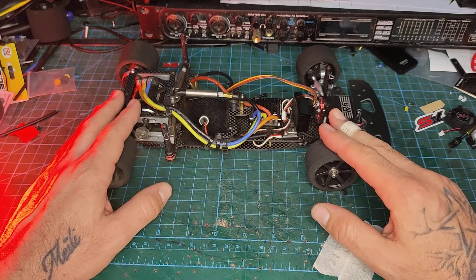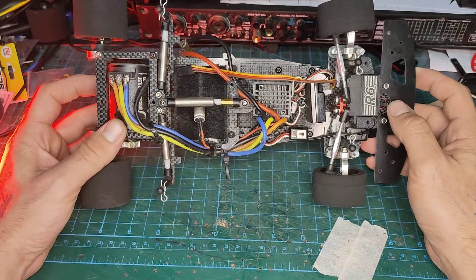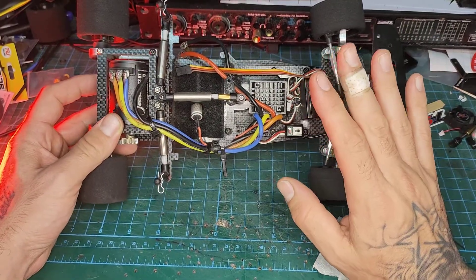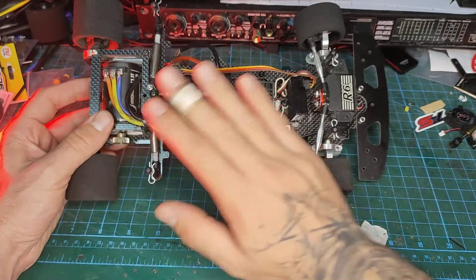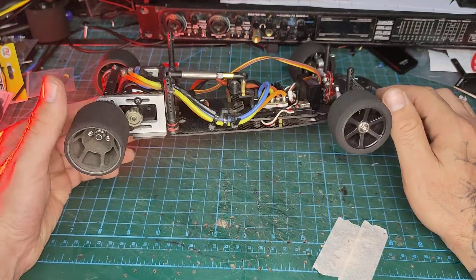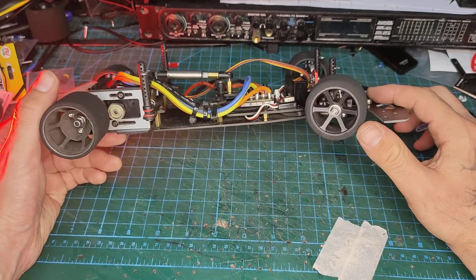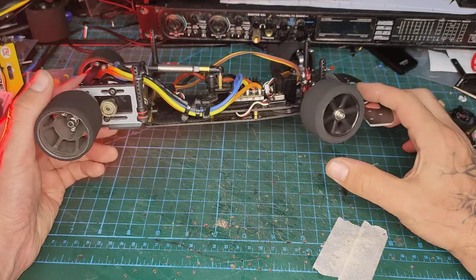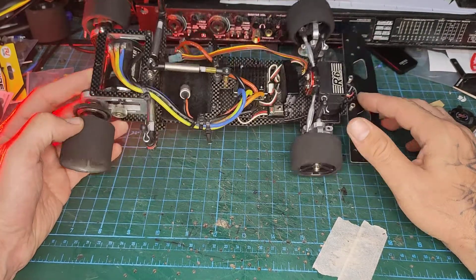This is the best I've had this chassis running. I'm running a 2S setup with a blinky 60 amp ESC and a 13.5 turn motor. I have my 112 R6 in the front and then JFT tires at the back — those I believe must be Matrix or some other tires, but JFT really is the way to go for those.